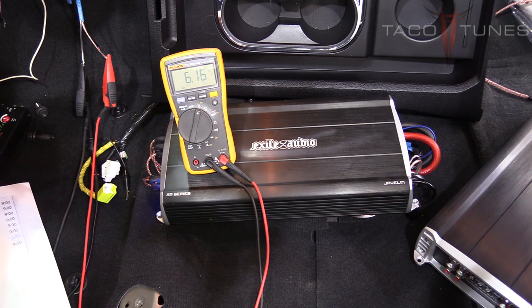At this point, we've got the front and rear gain and input sensitivity set, and the crossover—high pass filter—set at 80Hz for both. Our next step is to set up the subwoofer.